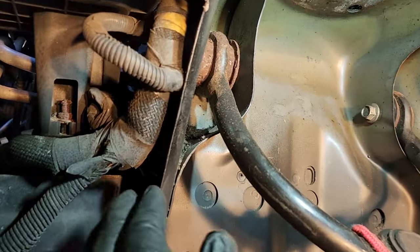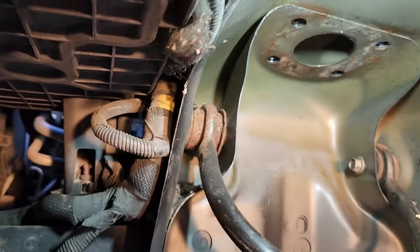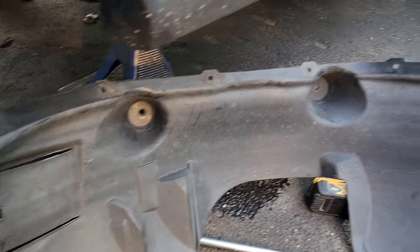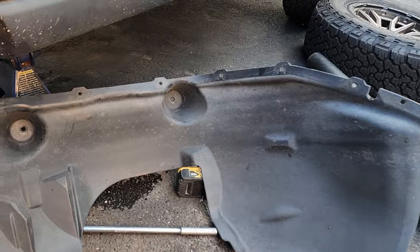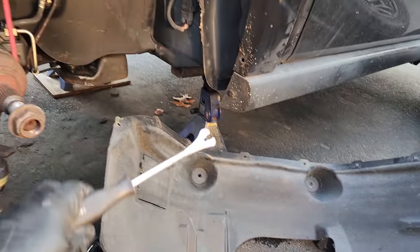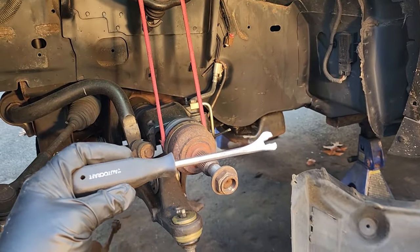All right, the front is a little bit more of a pain to get to because it's got this wire harness in the way. So I just removed the whole wheel well lining. It's not that big a deal if you have a little plastic rivet gun. If you don't, I'll leave a link in the description for you. It takes about 10 little rivets to get this guy in. They pop out easily with this little pry tool. And if you don't have one of these, I'll leave a link in the description as well.